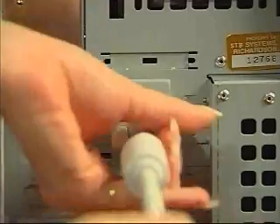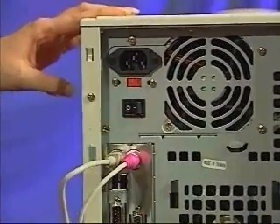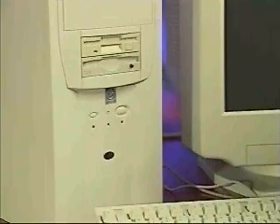After replacing your computer's cover and turning it upright again, you can begin the last step by reconnecting all of the cords ending with the power cord. Turn the computer's power button on and continue the Quick Install by installing the display drivers also provided on this CD. You have now completed Quick Install.